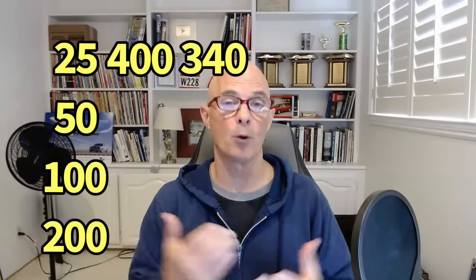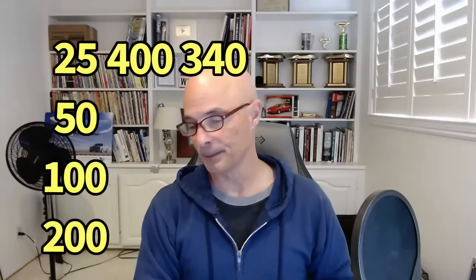If we move over to our next column, because we have to run the fuel richer when we're running a turbo, we're not running at 13 to 1 or 12.5 to 1. We're now running at 11.5 to 1. We need to run it richer. It requires more fuel. So the amount of power that it can support with that same amount of fuel flow will be less. To give you an idea, 25-pound injectors are going to support about 340 horsepower under boost.